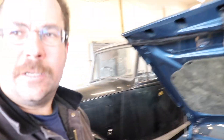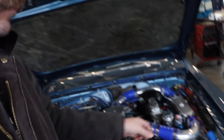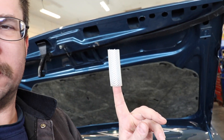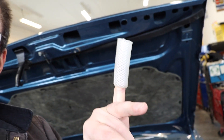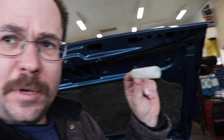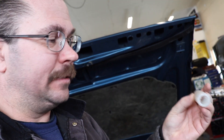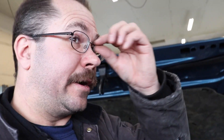With that I had to buy some new radiator hose and ended up finding this nice product from HPS — they make a lot of silicone products, sold as clear heater hose. It's not super clear but it still works. And that's led me to also find that these pumps, if they're turned on too rapidly, are actually cavitating — you can see that by small bubbles being formed before the pump. If it's pulling too hard through the radiator it creates a bit of noise, whereas the system should really be quiet.